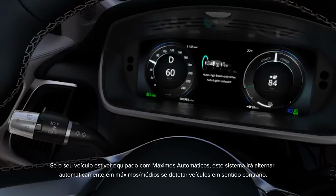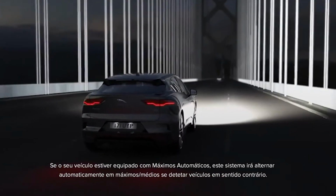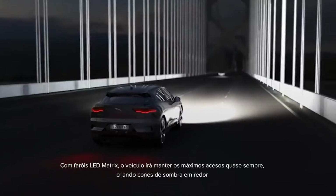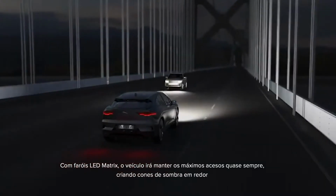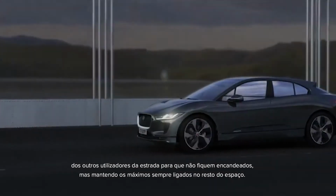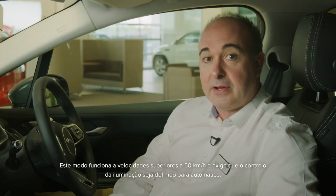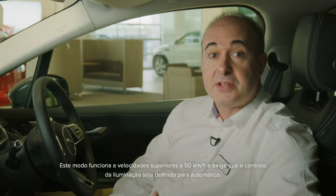If your car is fitted with auto high beam assist, the car will automatically dip main beam if it detects oncoming traffic. If you have matrix LED lights, the car will keep main beam on almost all the time, creating cones of shadow around other road users so they're not dazzled, but maintaining full beam everywhere else. This mode operates above 30 miles an hour and requires the lighting control to be set to auto.